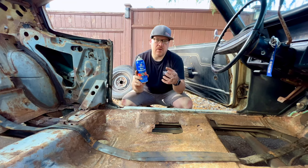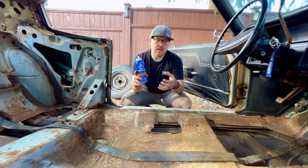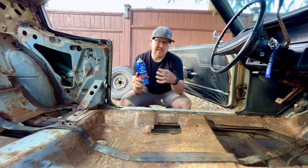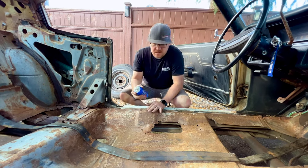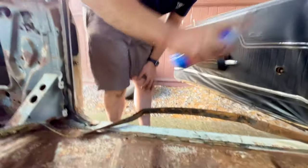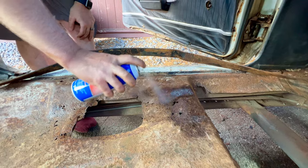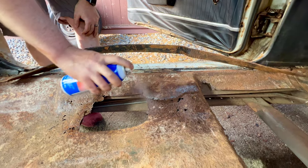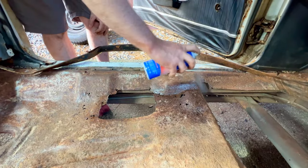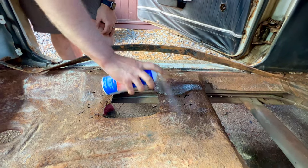It's going to chemically react to the rust, and it's going to basically turn it into a black coating that we can put paint on, and that locks it in where the rust won't grow or get any worse than it is. That's why we wire wheeled everything up, so that this will stick on and bond very good. But you just go like that, and then we're going to give it a couple hours, actually probably just let it sit overnight, and it should turn the areas black,